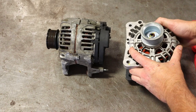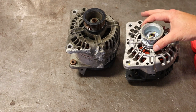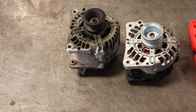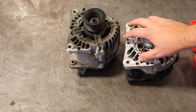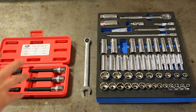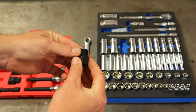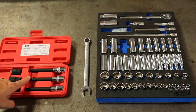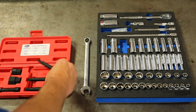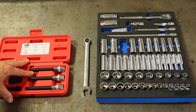Some of these alternators will have a pulley on them that will have a clutch — a plastic piece with a clutch inserted in it. That way, if it locks up or overruns, the belt's not going to be thrown off. You're going to need special tools for that. I'll show you what they are and put the Amazon link in the description. This is a Gates Kit 91024 ADP Toolkit. This kit has the piece you'll need for these clutch alternators and also a star bit in the center to remove it. It's a really good kit to have if you do a lot of alternators.